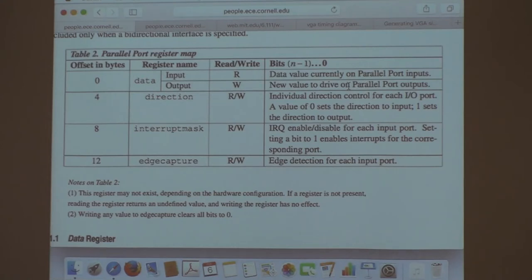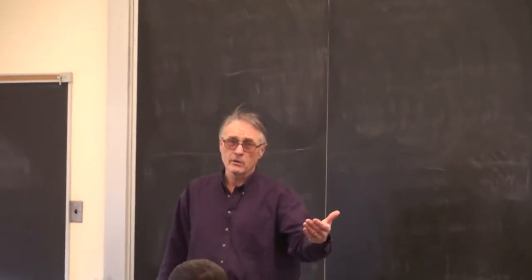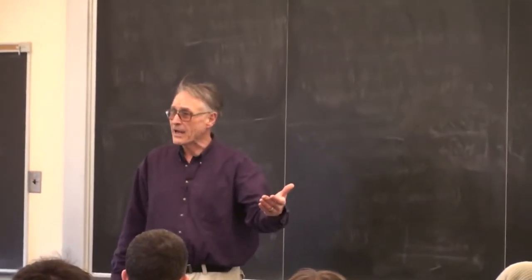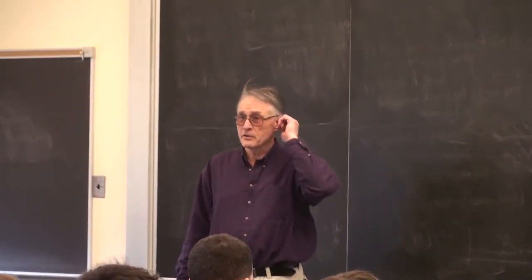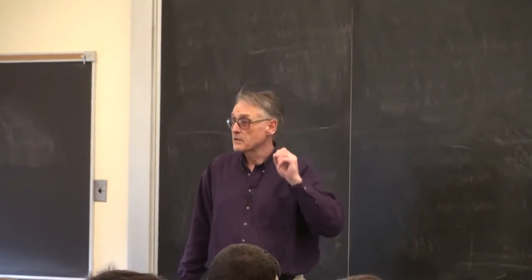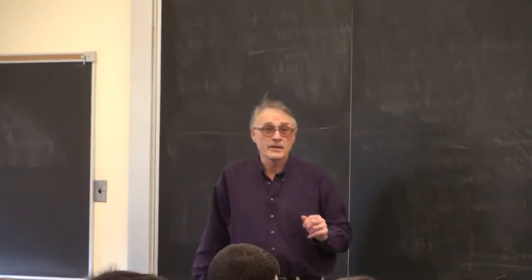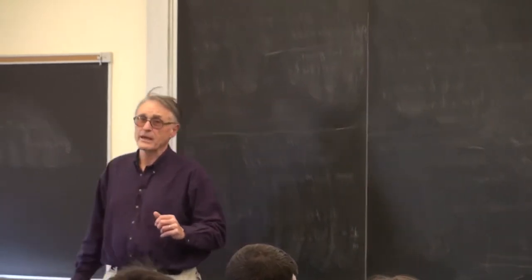Which reminds me, as soon as you have the SD card set up the way you like it, with the SSH stuff on it and everything and the right IP address, back it up. Keep an image on your laptop, because you will blow these drives. And then you'll start over if you haven't backed up. Backup.